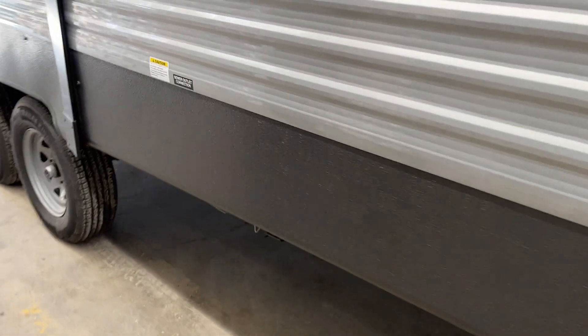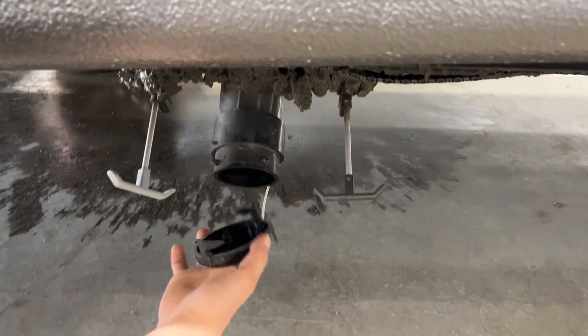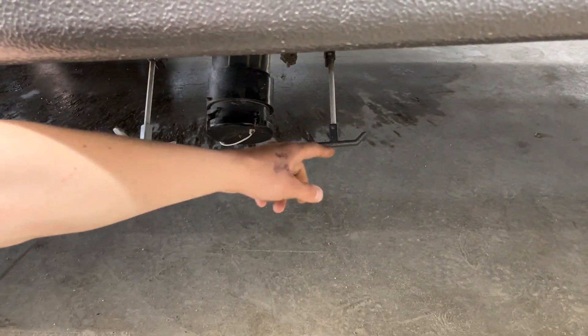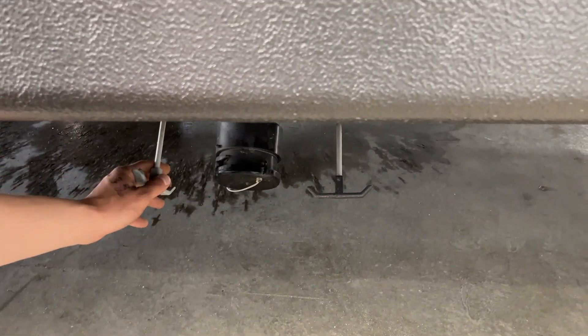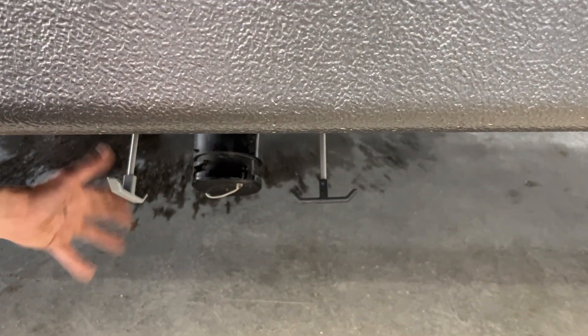A couple of steps down the side of the unit, you'll find your sewer system. Press on that cap and give it a turn to pop it out — you can see it's got the same ears that your sewer hose had, so it attaches the same way: press it in and turn until it locks. On the left you get a gray valve, on the right a black. The black valve controls your black tank, which is filled from your toilet — the dirtiest water — so we dump that first. Then come to the gray, which is filled from your sinks and shower. Typically cleaner, so we dump that last to keep the sewer hose as clean as possible.